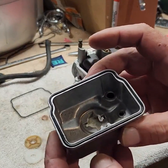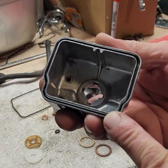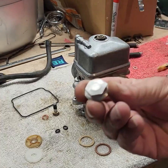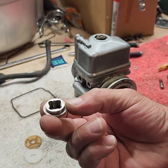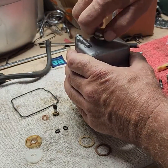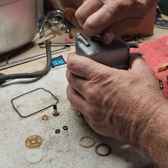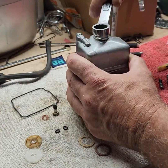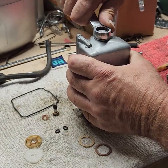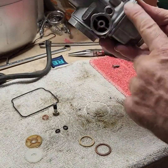Take the float bowl — right upside down — put it on. I put a new ring in here. This is the nut that goes on over it, screws onto the main jet. Snug that down with your fingers, then grab your 17 millimeter wrench. No Hercules — you're just snugging that down enough for the O-ring to seal around there.